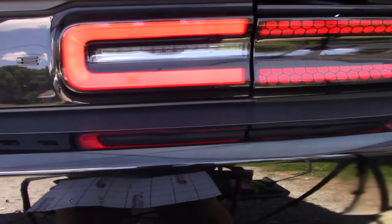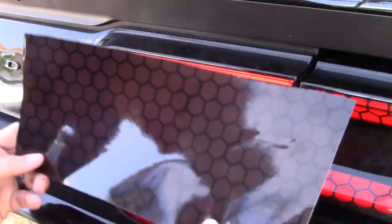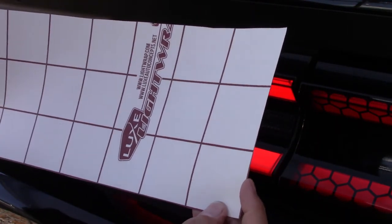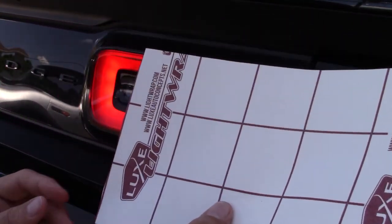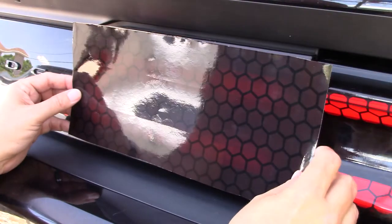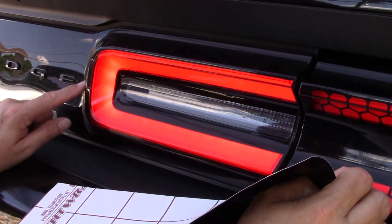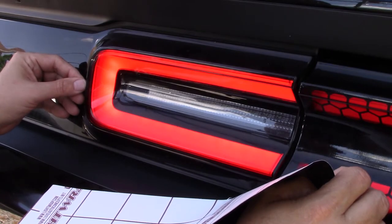So here we go. So you see, after I'm done cutting it, if you look on the back, and these are 2-inch blocks, so I'm left with 6 inches, 3 blocks by 1, 2, 3, 4, 5, 6, 7. And so what you're going to see is that when you put this up here, I get my overhang over here to this side, and this is coming way down beyond where I'm going to. You just basically come off this lip right here, just maybe 1/8 inch off that lip.